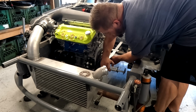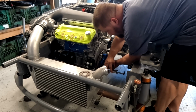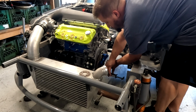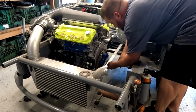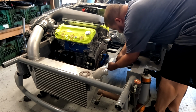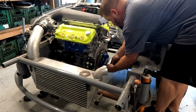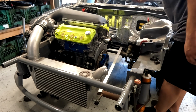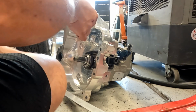Wow, seriously? My hands are not working. No, gotta go center, stupid. Exactly 2.5. How much is that? 2.502. Okay. What is our measurement from the face to the diaphragm itself? Literally like next to nothing. 0.065. I mean, it's not nothing, but 2.2. 2.232.